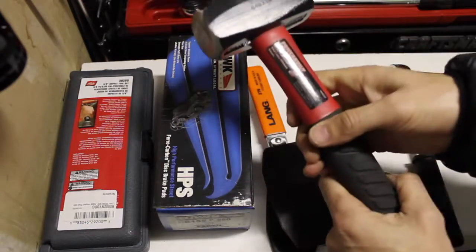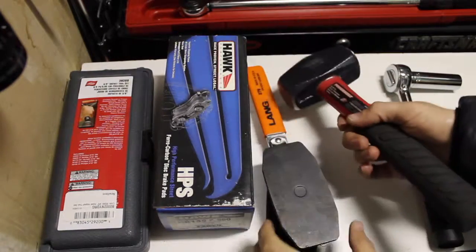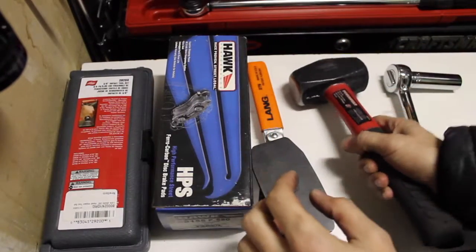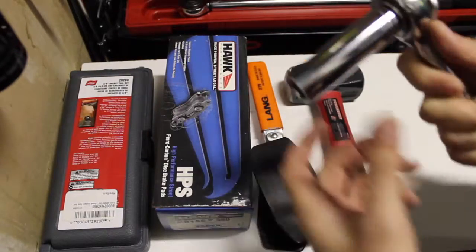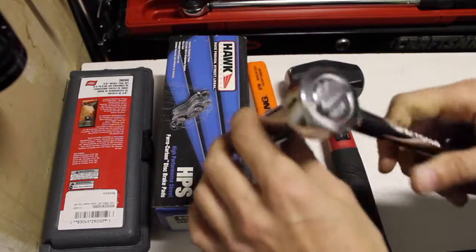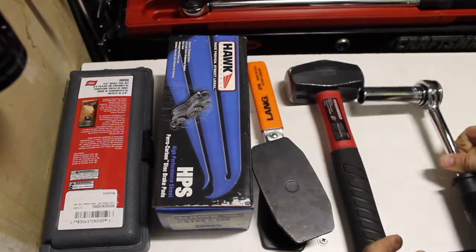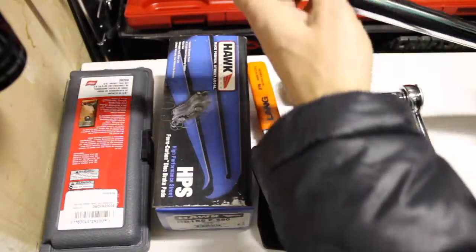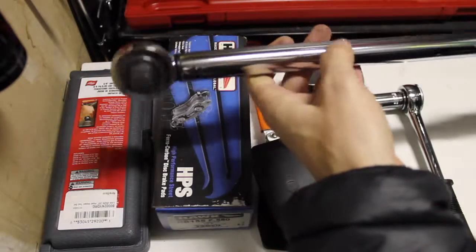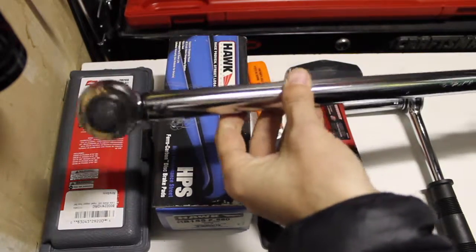Next, you need a little mini power built sledgehammer. This is for removing some pins or some clips, as well as using the impact tool screwdriver for removing the rotors. And then I've got a 17 millimeter half inch deep socket. We'll use this to remove the brake caliper from the system. And then finally, we've got a torque wrench here for putting the lugs back on, and also this is good for using as a breaker bar in order to get off our 17 millimeter bolts from our brake caliper system. So these are the tools that you're going to need,